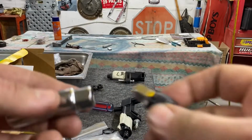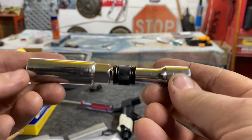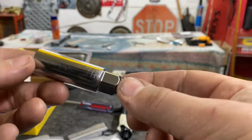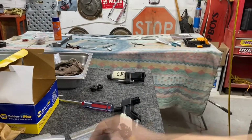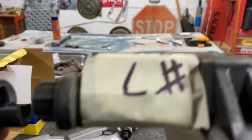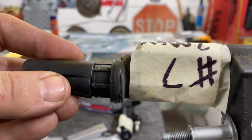And you know, doing the spark plugs on this thing is a nightmare. So I can't go into full detail on how to do everything. Someone's gonna have to find their groove, but I just want to help point out some pieces. The other thing that's a problem is these things break the spark plug boots super easy.